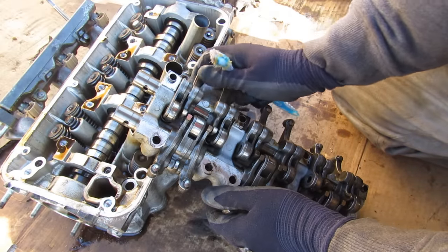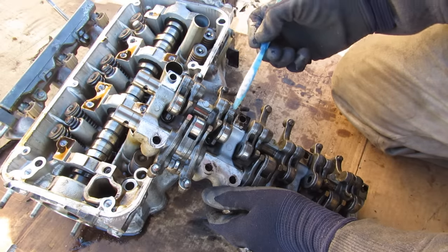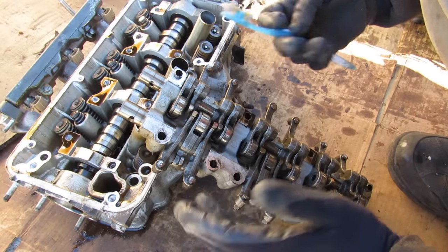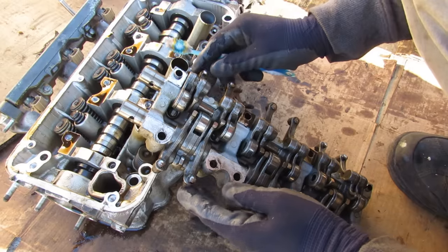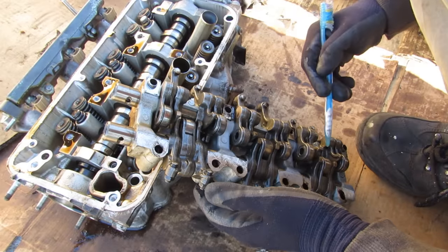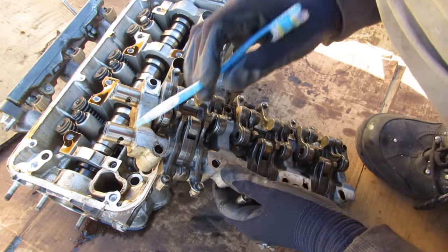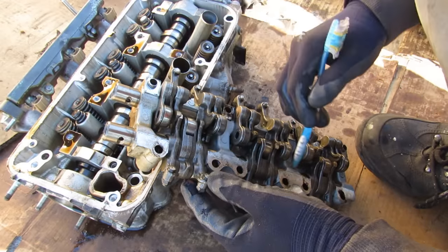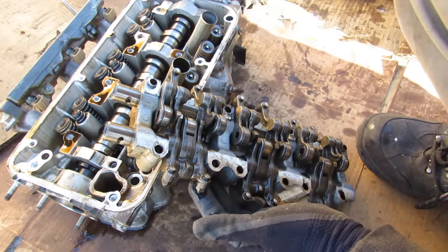On the exhaust side, the two roller arms on the outside are locked respectively with their pins to the rocker arms that activate the valves. In the rest state with no oil pressure running through, these are in the locked position and your engine starts up like a normal six-cylinder. The system has two big shafts that run along its length, allowing these to pivot against each other. They also have holes which are oil passages that allow oil pressure to go inside and deactivate the pins locking these together to engage variable cylinder management.